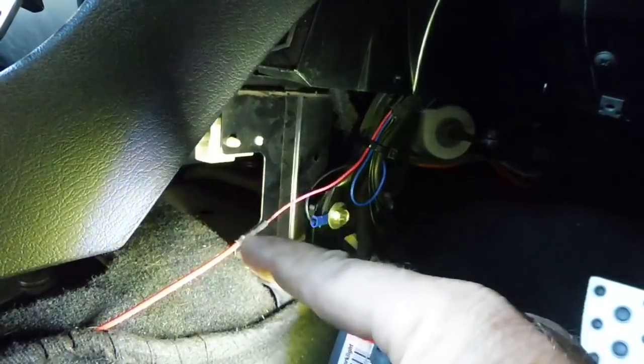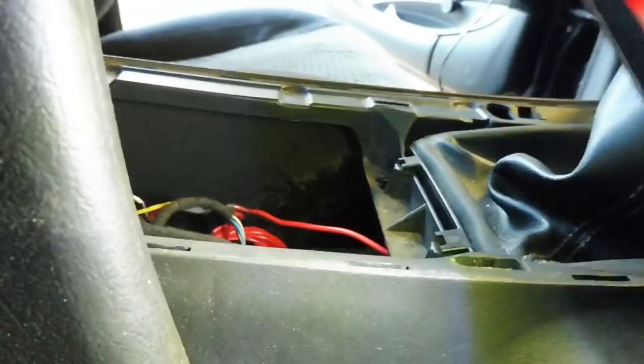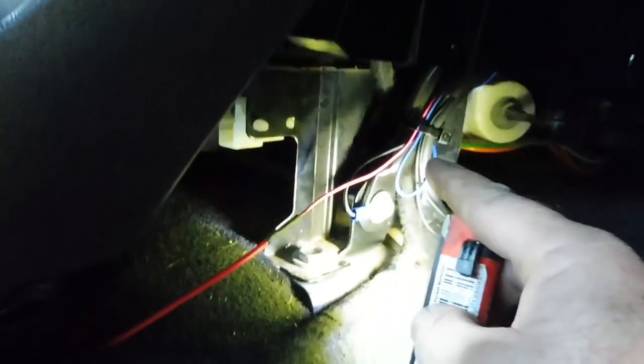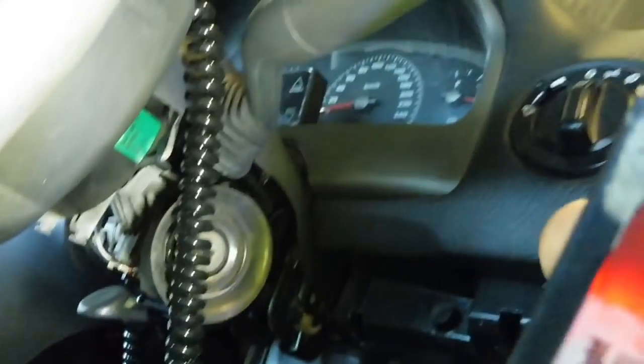This is the switched power wire, so it's ignition switched, and I got that. This car's not power windows, but there's a power windows plug still there from factory, so I tapped into there, heat shrunk, solder. And then the blue wire coming out of that plug is the one for the dash switch, which you can see I've coiled up there.